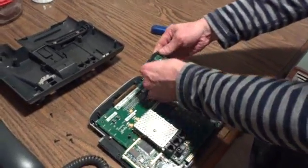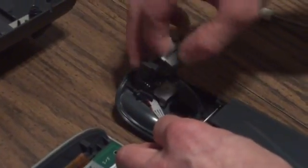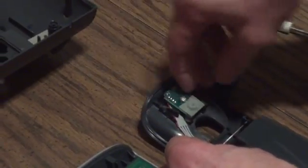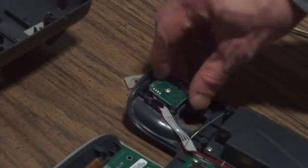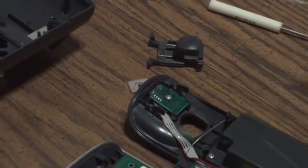This is what you want to fix, right here. Here's the spring — it's just a little loop. So you take this off. On the 7960 phone you just take this right out. On the 7961 it's permanently in there — you have to kind of flip it up. It's not permanent, but it's a little harder to deal with. Take off the little rubber thing here. That's the connection right there. Silicone seeps through this board, clutters up the connection, and it doesn't make a connection anymore.